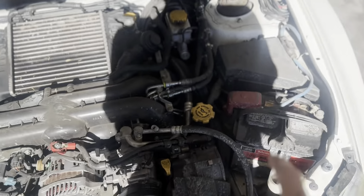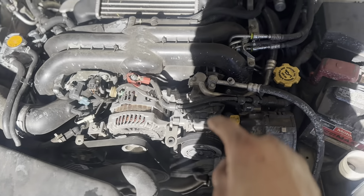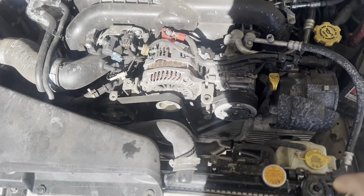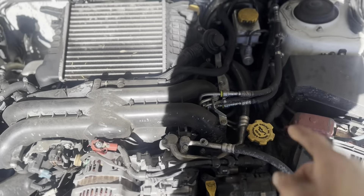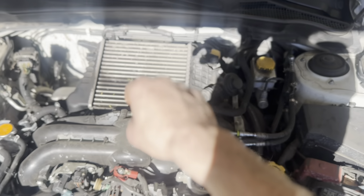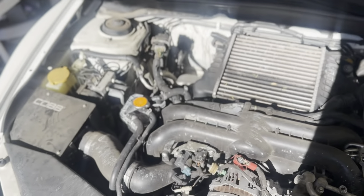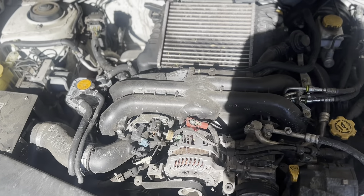I'm going to pull off intake, intercooler, heat shield for the turbo, battery, accessories right here — power steering pump, AC compressor — and then coolant lines in the back, radiator across the front. I'll at least describe what I'm doing. You have fuel lines, brake master line that comes through the back of the manifold, coolant reservoir, one electrical connector, ground straps on the bottom of the motor, and of course bell housing bolts.